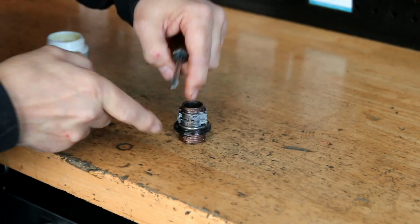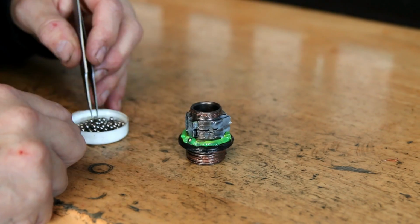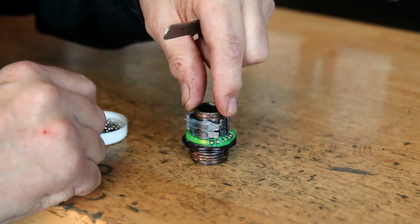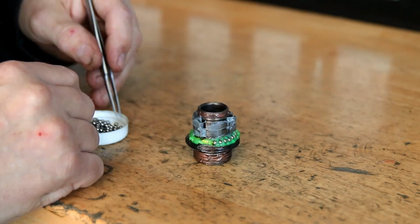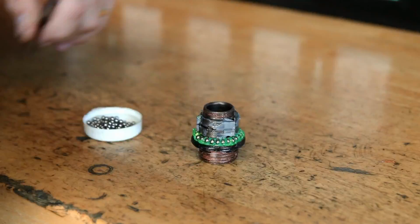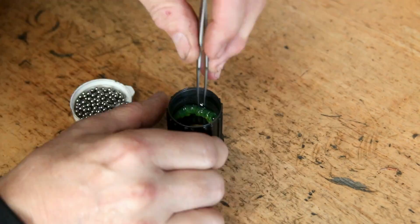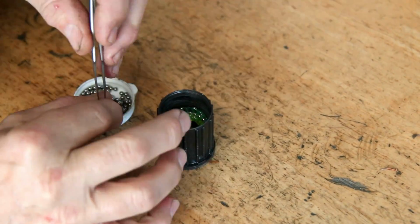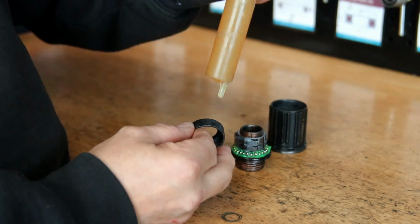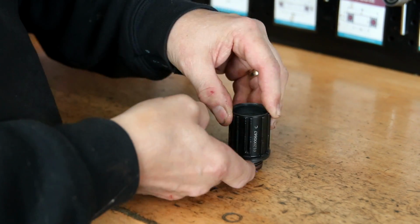And then we're going to use the Shimano premium grease here on the bearing race itself before replacing all the bearings with new ones. So you can see there we've already got 3 greases involved, and then we're going to use a general purpose grease just to wipe around the lock nut and the top race that goes inside here, just so that slides inside nicely, so that as I'm putting everything together, we're not going to get any of the bearings falling out of that grease and causing us a problem as we put it back together. So here comes our general purpose grease, the 4th grease in this process, before we then put it back together.